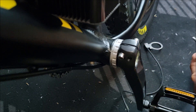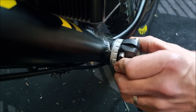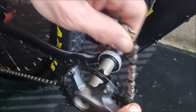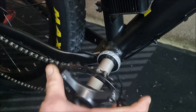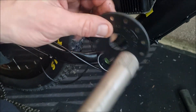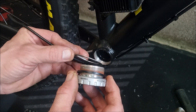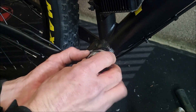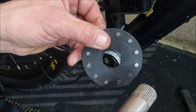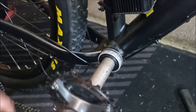Finally, I just need to install the pedal assist onto the crank. Remove the pedal, slide the crank out, make the pedal assist magnet holder hole bigger, remove the crank sleeve, slide on the magnet sensor, tighten back up, push the magnet on the crank, and reassemble the pedals back together the way they came apart.